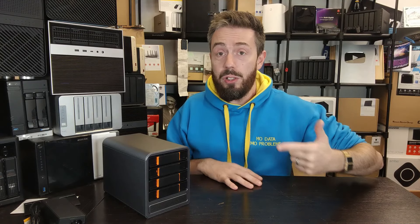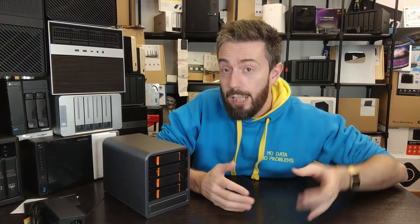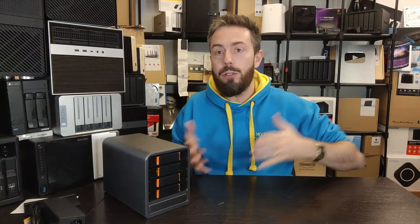There's no means to do much with the M.2 NVMe — because not only is there only one, that means it's occupied by the SSD you bought in the shops with the OS on it. If you're going to run something like TrueNAS, you're shafted, because that SSD becomes the OS drive, which means you can't use it for caching.